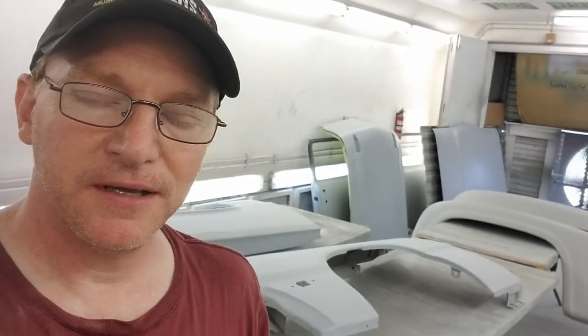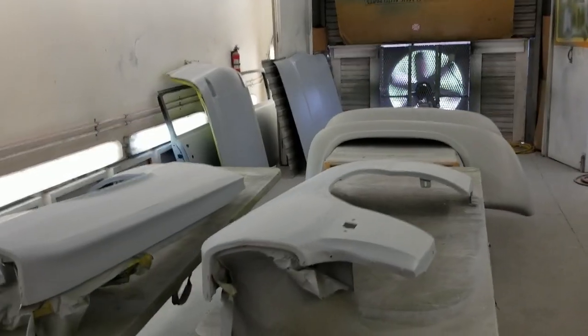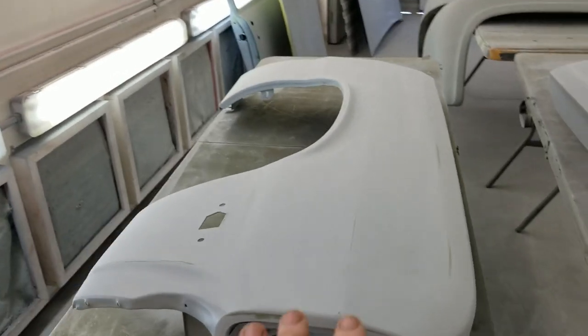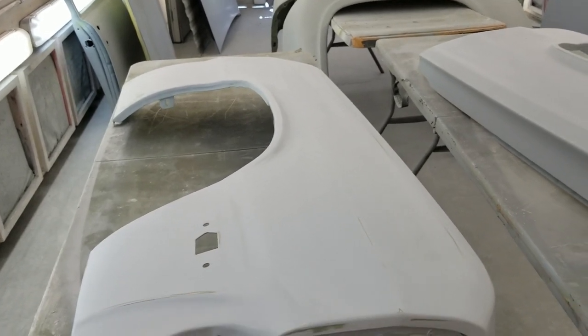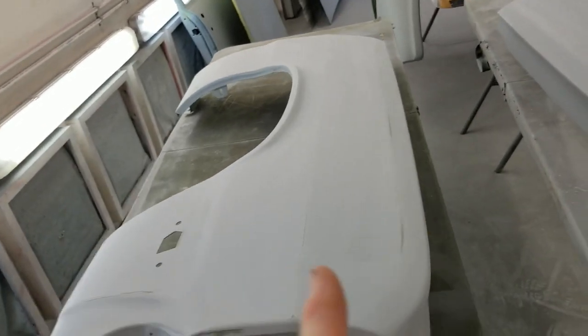What is dieback and how do you get a panel straight? I'll show you a couple quick tips that we've adopted in this little tiny shop for restoration. I have two Plymouth fenders, 73 to 76 fashion. What I want to show you is a way to tell how flat you are when you're blocking and doing body work. I'll show you an area that died back again on me — sometimes this happens to everyone. These are A-body Mopar fenders, and the subtle body lines are always the killer on these. They'll get you all the time.